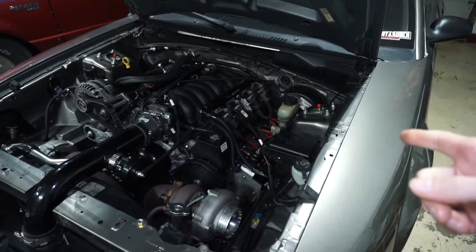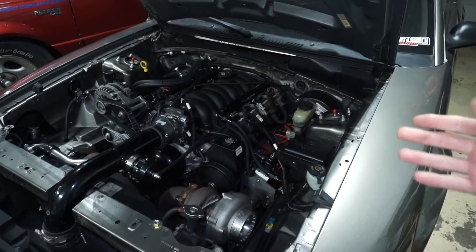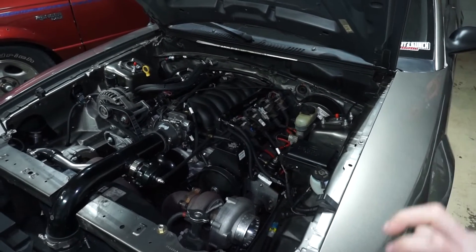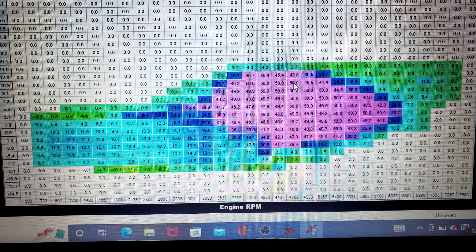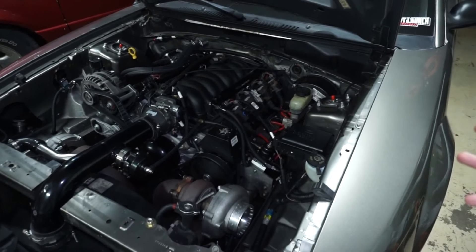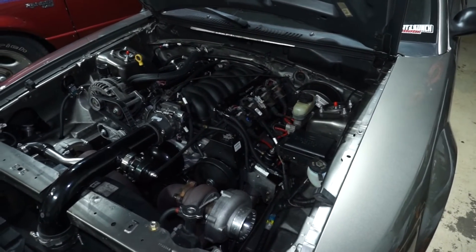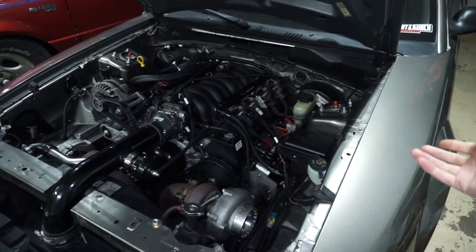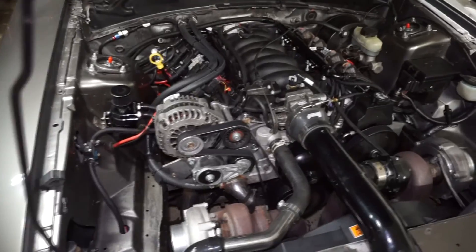It's a TH400 so it probably doesn't have lockup, meaning you're kind of always going to have a higher RPM while cruising unlocked, which adds a lot more heat to the transmission. I pulled the file off the ECU last night just to look at the inputs and outputs, and I checked the fuel learn table. There was a large section where the fuel learn table was pegged at 50 on like 11 pounds of boost — at peak torque around 4,300 to 5,000 RPM. Good chance it needed quite a bit more fuel. I'm probably going to do a compression test, maybe bore scope the cylinders, and make sure all the pistons are good and that it didn't hurt anything. More to come on this thing.